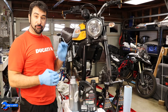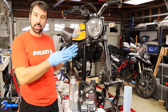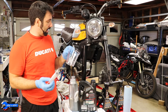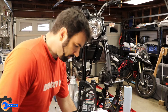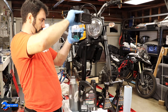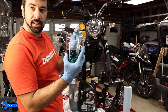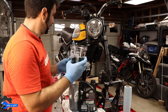At this point we need to pour 427 cc's of oil. According to Ducati there is no way of checking the oil level inside the fork once it's put back together, so they give you a very specific amount of cc's that need to go back in. Get a measuring cup or a syringe — make sure whatever you use is clean. We have exactly 400 cc's in this cup and another 27 cc's in this syringe, so let's pour them in.